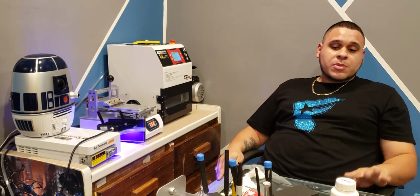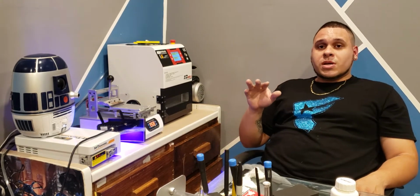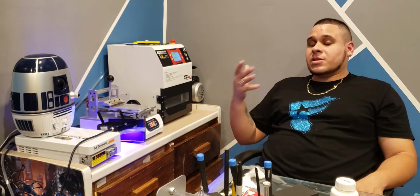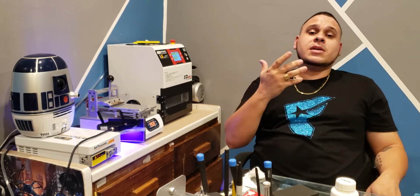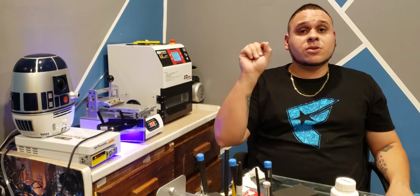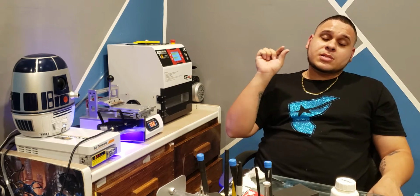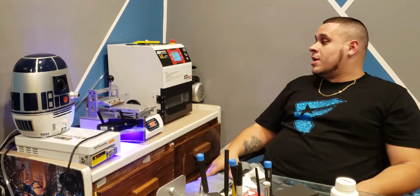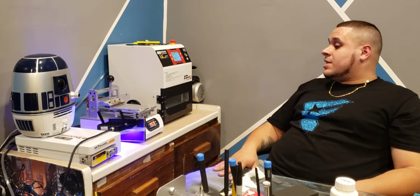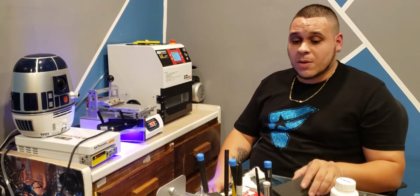As far as what I'm doing here, other than having a clean room and making sure there's no dust on there, I'm visually checking, and I can tell my bubbles are not from dust. If they're from dust, you can see it in there, and the bubble will never come out. But these are just air bubbles. So after seeing this, I'm going to see if it comes out of the autoclave without bubbles.